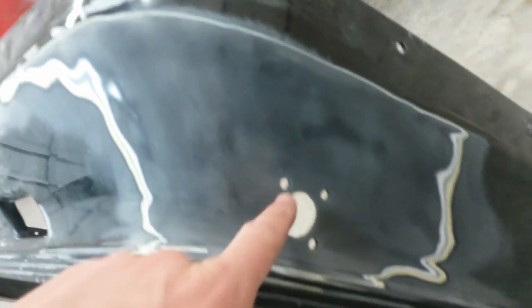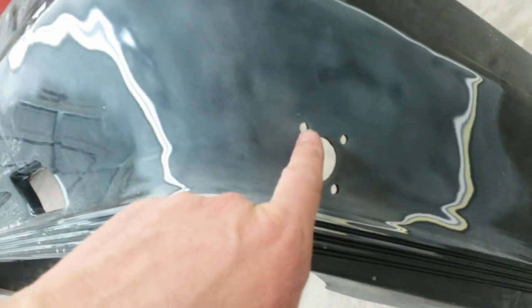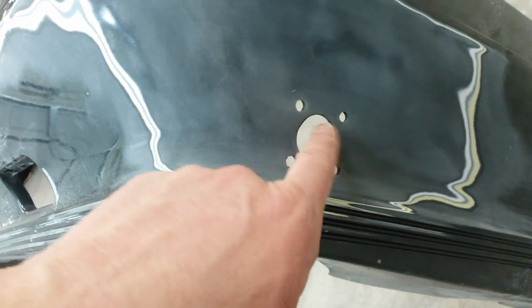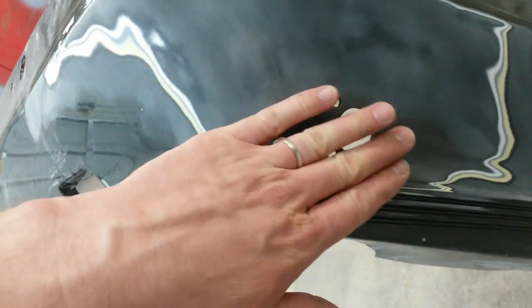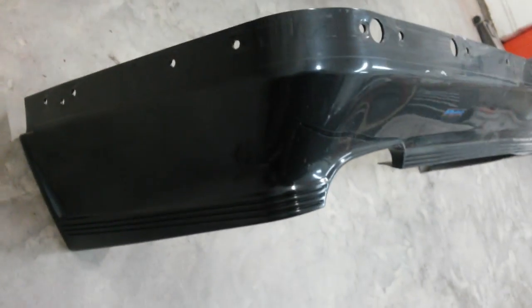I'm getting the rear bumper sanded out where I need to fill these holes in where that port was. I need to get a different adhesive to make that structural repair. What I'll have to do is dish these out and put a little bit of a taper on each edge of the hole. I'll come in from the back, tape the front, leave it domed, and shove the adhesive in from the back to fill through the holes and come through the front. Then I'll grind all the front down flush again and fill over the top of it with some surface filler. The rest of it's pretty good — just need to strip the paint off after I do the repair.